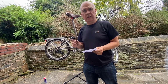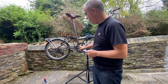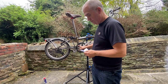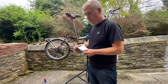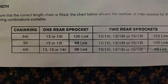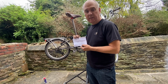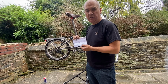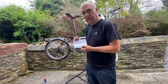Now, the only other thing to bear in mind when you're changing the chain is to get the right length chain. The chain that you'll need is dependent upon two things: the chain ring that you have at the front, which can be either 44, 50 or 54, and also how many gears you've got, so whether you've got one sprocket or two at the back. There is a diagram that comes with the chain, so I'll put a photo of that on for you now. And also I'll link to that in the description below. So it's on the Brompton website, and most of the suppliers of the chains as well will tell you that. Certainly if you're going to someone like SJS or Brilliant Bikes, they'll have that information for you to make sure you get the right chain. So that's the only other thing to take into account.